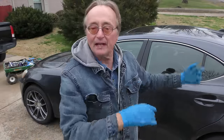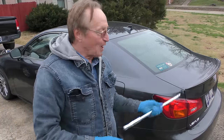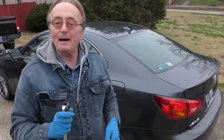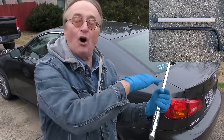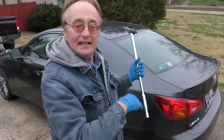Stay away from people messing with your tires if you don't trust them, because they can really mess things up. You get a flat tire in the middle of nowhere and you can't get it off — too bad. But if someone put it on with a torque wrench, anybody can easily get it off. As a side tip, try to get tools like a long breaker bar and the socket that fits your lug nuts and throw it in the trunk, because the wrench that comes with the car is usually way too short. If you're cheap, you can get the short one from a hardware store and buy a length of pipe to make it longer — they're still made of steel and will give you enough leverage so you don't end up in this mess.